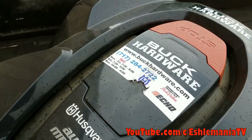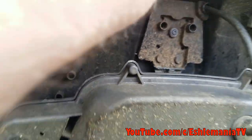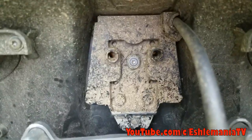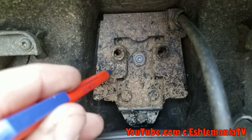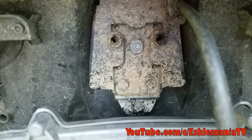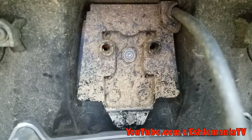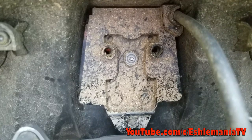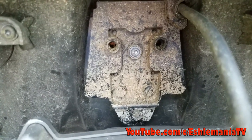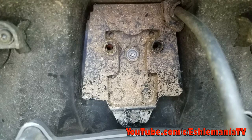The next thing you want to look at — and what is usually the problem on these 2016 and early 2017 models — is right here under your charging plates. Directly under the nose of the machine where it goes into the charging station, this plate here: if it is black plastic, there's a good chance you've lost this little barrel-shaped magnet. It can fall out, get lost, or get in there sideways. It works with the lift sensors and collision sensors, and if anything happens to one of those magnets, the mower thinks the body is completely missing, lifted off, or not secured, causing the whole mower to stop.